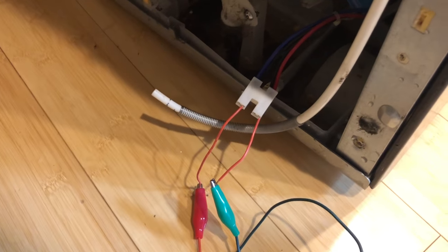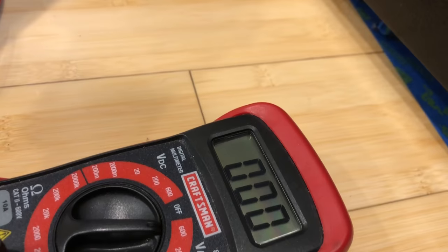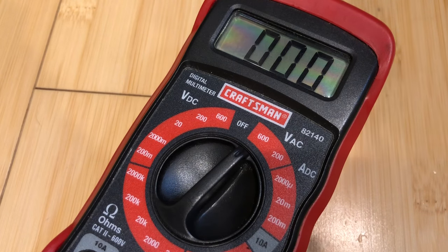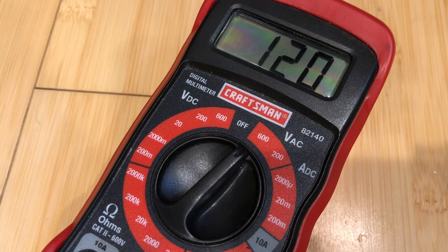If you're interested in testing whether or not the solenoids are actually getting the proper voltage, I did this quick test - I put a couple of jumper wires into the main plug right into my voltmeter and confirmed they receive AC current. Set your voltmeter, switch the refrigerator to water dispense mode, press the button, and you should see 120 volts - just like that. That's the main switching solenoid. Now with the leads hooked up to the plug on the right hand side, which is the water dispensing solenoid, we switch to water mode and press the button - and we're seeing 120 volts there too.